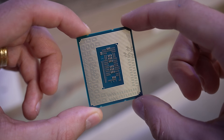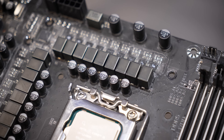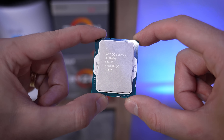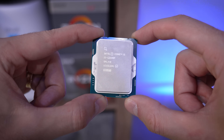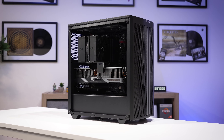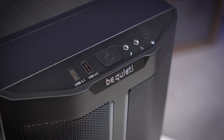I haven't had any issues and I've used this chip for about six months, but I don't expect that the chip is actually to blame. The motherboard is a Z690 Gigabyte Aorus Elite AX — we've used that in several videos and it has worked up to now as well. I also tried a 12th gen Intel Core i5-12400F, which has not worked in this particular combo of hardware either. Essentially the rig turns on but it doesn't post. I've tried BIOS updates, QFlash Plus, and manually booting into the BIOS with a 12th gen native chip, and I still cannot get the system to post. The 12400F doesn't even get hot, neither does the 14900. I'm completely at a loss for why this system just doesn't want to play ball.